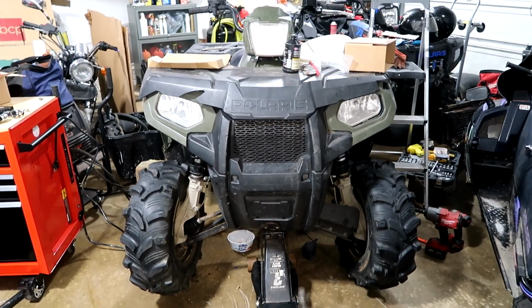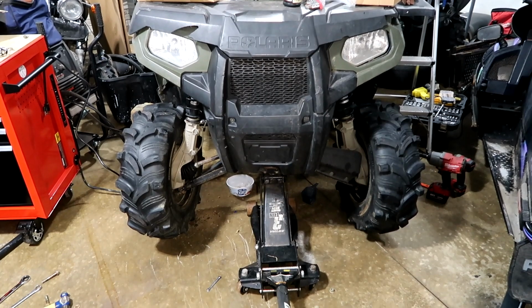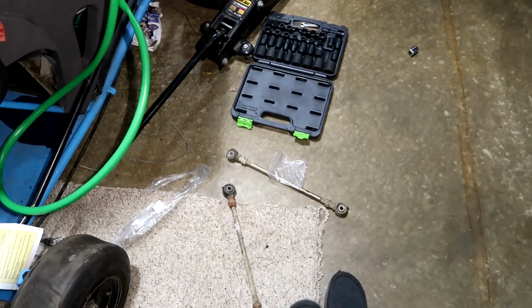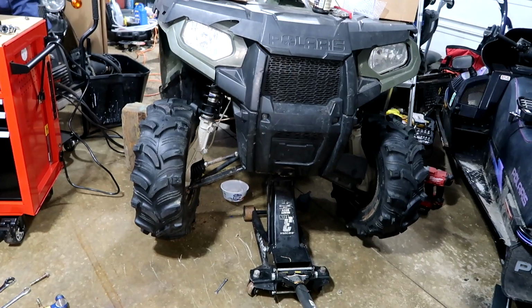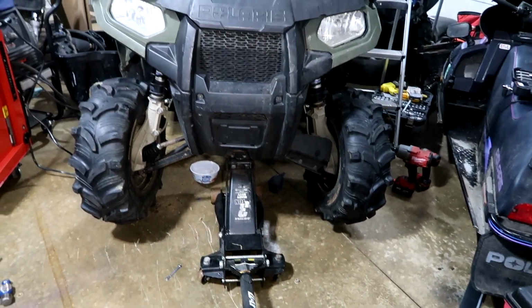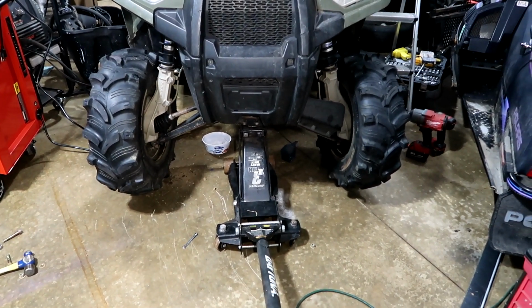So I just got everything installed back on, and you can see my handlebars are nice and straight and my tires are not nice and straight, sadly. I adjusted them to what those are, so they must have been a different length. I should have checked that, but I'm just gonna crack the nuts back loose and spin the things till the tires look straight enough. So yeah, that's kind of tragic. I didn't notice until I put the tires on. So let me fix that.